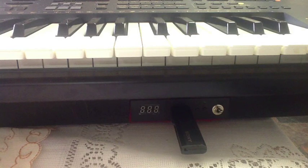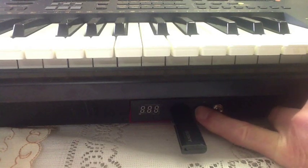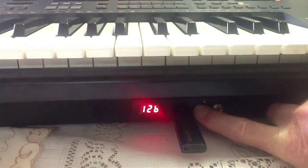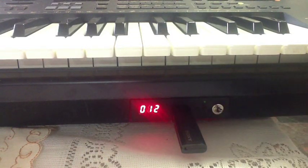To format your memory stick to work with the unit, it's quite simple. Press the two black buttons together, push them in, and power up the unit. You'll see it come up with FO1, which means it's formatting. Normally it will count to 1000, and then your memory stick is ready for use. If you have any problems getting it going after that, just turn the keyboard off and back on again and it should work fine.